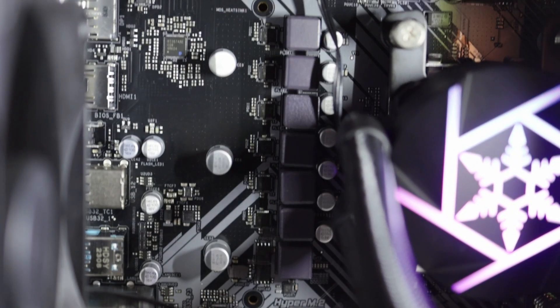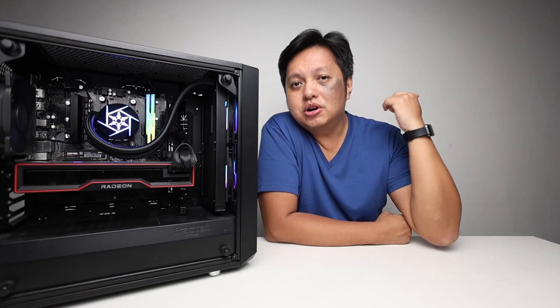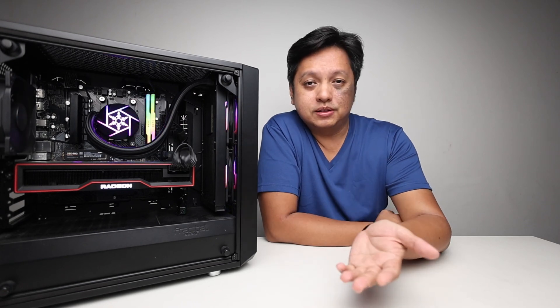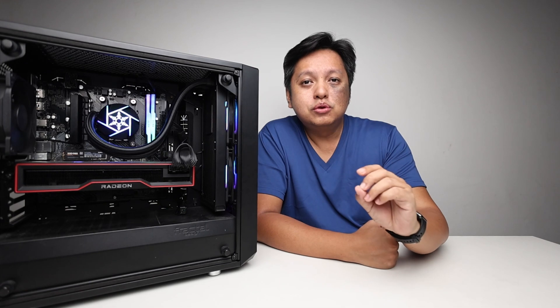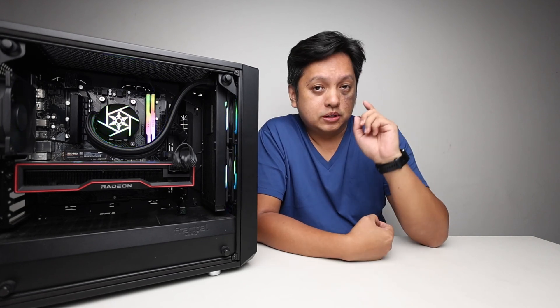Here's what I can tell you: if you are going to run multi-core workload with bad airflow and all that, it is going to hurt performance. For a single-round Cinebench R23 — a 30-second task — it goes through just fine and the scores are exactly the same. But if I run it for 10 minutes, you can see that halfway through it throttles very badly. I have a screenshot of one of the moments where all the cores are running at less than 1 GHz. This shows how severely it throttles without a VRM heatsink.